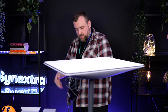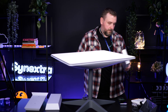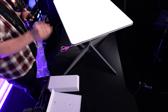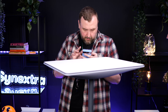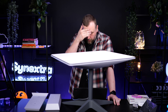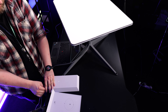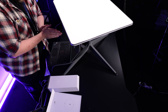Let me plug the router in as well. This is the LAN — so this is actually a router, and it's going to go into my firewall. We've got the Starlink router connected and plugged in. The power supply connects to the receiver on one side, and to whatever your router is going to be on the other. In this case we're using the Starlink router for this test. The Starlink router by default only has two ports — power and the data from the receiver — so it's doing Wi-Fi right now.